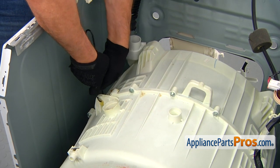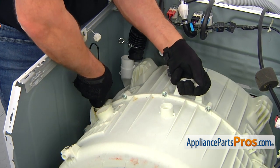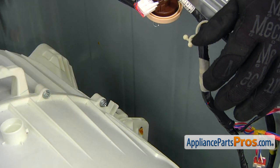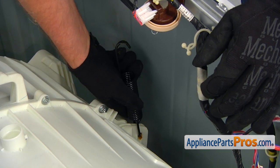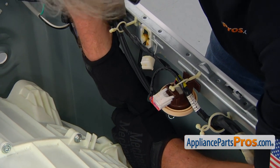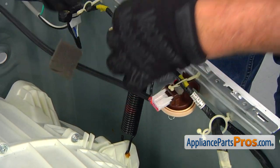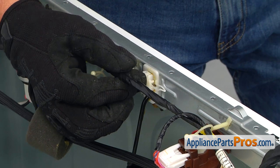If it's heavy, call a second person to help. Then close the safety lock. Install the bottom hook into the opening in the tub socket, grab it with both hands, lift it up, and install the spring into the spring holder. If it's heavy, ask a second person for help, or use a rope as a tool to pull up the spring with both hands. Then close the safety lock on the spring holder and push it in.